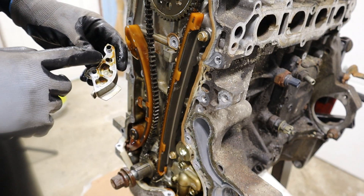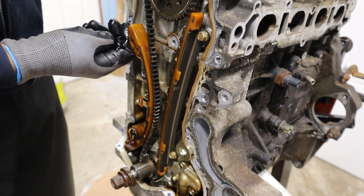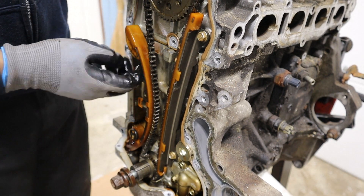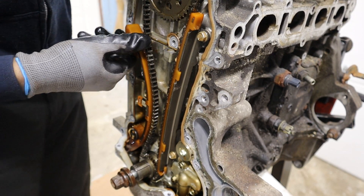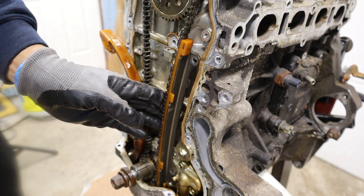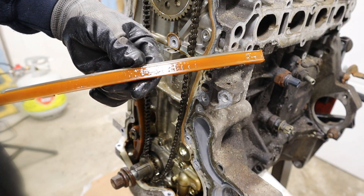It is a leaf spring — that's cool. This tensioner is not hydraulic; it's just a fixed piece that pushes up against this piece over here. Once those two bolts line up, that sets your tension. All of the tension is in this leaf spring. That's what keeps the chain tension. Look at that tiny little timing chain slide — it's so thin.